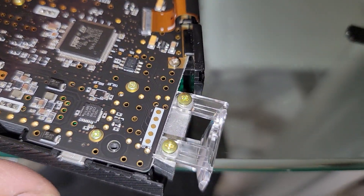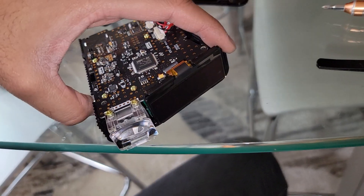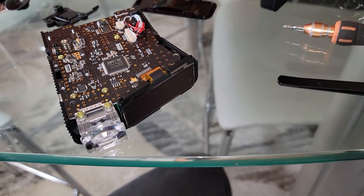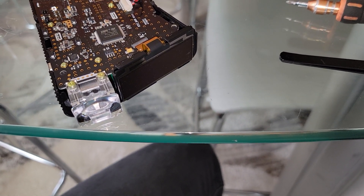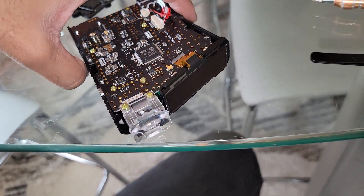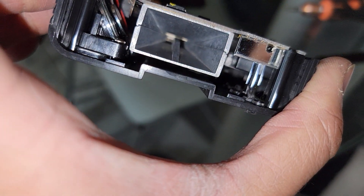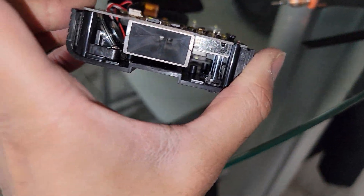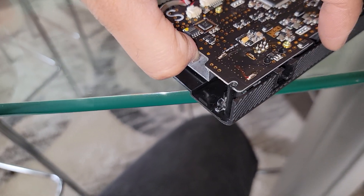And have this work as a remote unit. For the screen, this is an FPC cable right here. You can actually get an extension FPC cable and put the screen wherever you feel like inside the car — you could even mount the screen right near the original speedometer or anything in the instrument cluster, and it would look like it came with the car. I might try this in the future, mounting it in its individual pieces.